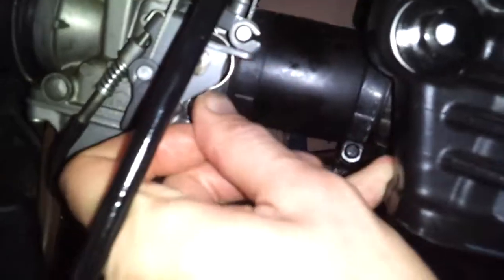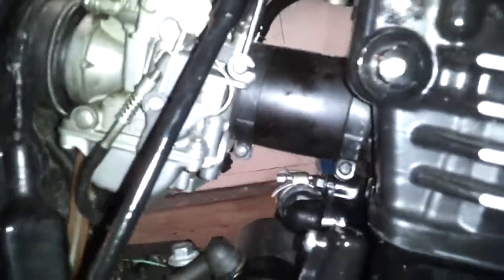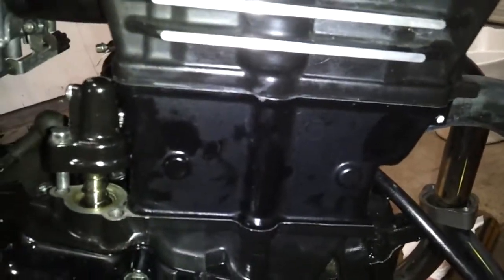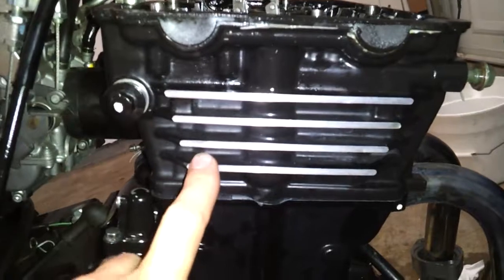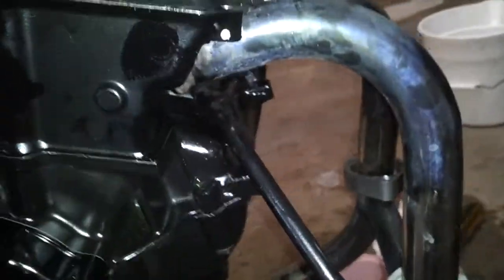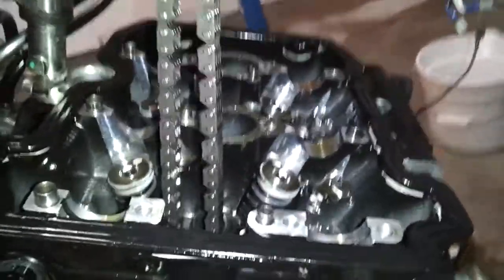All bolts out — I loosened the carburetor side of these rubber intakes, and really all you have to do is push them apart. I already separated the other side, so those came apart pretty easily. I've heard there's trouble putting them back — sometimes you have to boil them in water for about a half an hour to get them soft enough. You can see that little split right there. If you just start pulling up on this like I did you're going to take the cylinder head with you. Make sure you don't forget about this little bolt down here — that's a 10-millimeter.